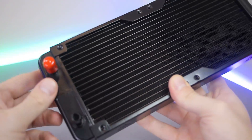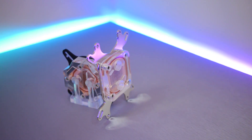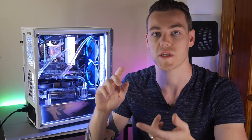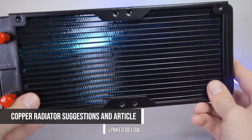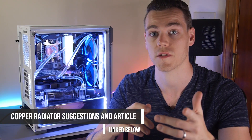Another concern — looking inside the radiator it is almost definitely aluminium. As we have copper blocks, our rate of galvanic corrosion is going to exponentially increase if we don't treat this mixed metal loop properly, using a good anti-corrosive additive and replacing the fluid at frequent intervals. I'll drop a link to suggestions for making it a full copper loop in the description, and a good article from EK on mixed metal loops. The liquid coolers that most of you are using are mixed metal loops anyway.